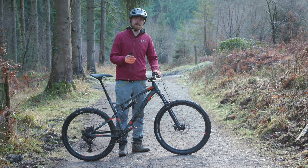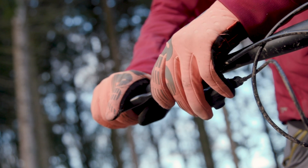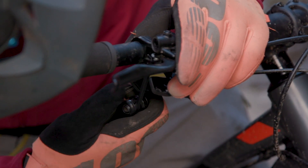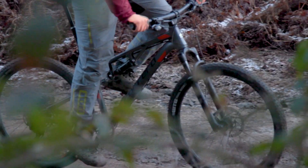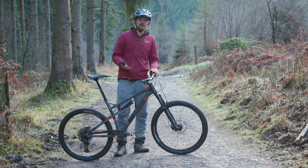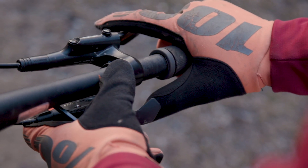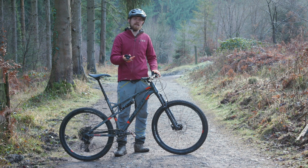The next thing to think about is the angle of the brake lever. There's a lot of personal preference that goes into this, but I find if the brake levers are relatively horizontal it makes it easier to move around the bike and push into the bike to get more grip. To adjust this, have the bolt loose enough that the brake levers will easily move up and down without scoring the handlebar, but not so loose that it moves side to side. Once you find a position you're happy with, tighten that bolt and check that the other side is at the same angle. In a similar way, you can move your shifter and dropper post remote inboard and outboard as well as up and down on the handlebar — and in some cases that may involve swapping the position of the brake lever and the shifter around.